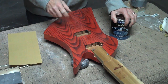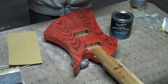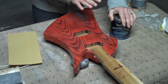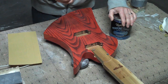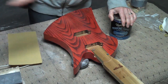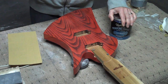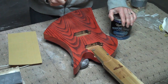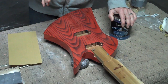To check the thickness visually, it's important to understand that as you're spraying, you want to be able to see that the surface is evenly covered and that it's wet. If you start to see that bluish haze, you know it's time to start backing off. You don't want a really strong milky, bluish cast to it. If you do, there's always the potential that it's so thick it's going to start to run.